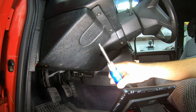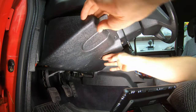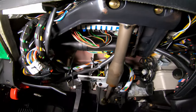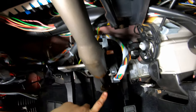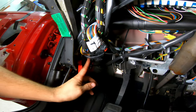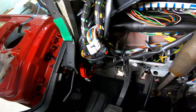We need to remove this panel right here under the steering column - it's held in place by three Torx 30 bolts. Pull it straight out. So let's dive in here and take a look. Over here is the ignition module - it sits right here, it's called the EZK116 - so we're going to get that removed. Then we have the big harness coming out right here, just like on the other side - this huge harness where everything goes into. We're going to open this up and basically do the same thing: just pulling wires until we get the harness out.